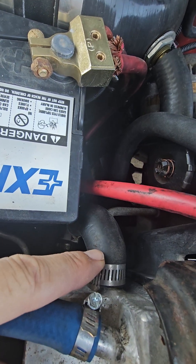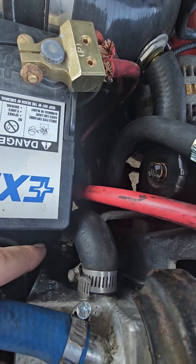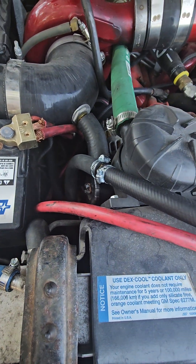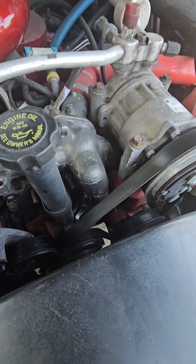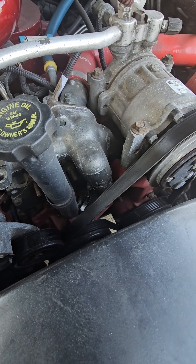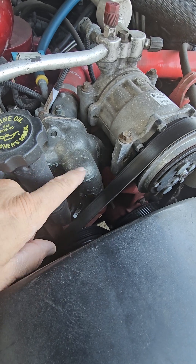All this hot water — a similar theory to my bypass restrictor fitting — is going from here straight back to the engine. On my water pump bypass fitting it's the same kind of thing. Also in the chain of cooling would be the bypass restrictor fitting, which goes on top of the water pump and on the dual thermostat housings.